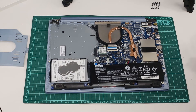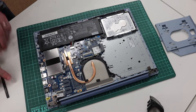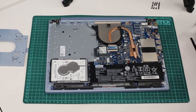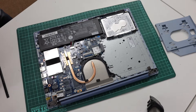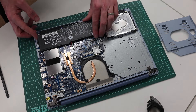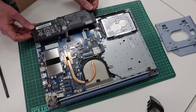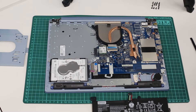The next thing we want to do is deal with the battery connector. The easiest approach is to remove the battery entirely. There are three screws holding the battery in place. We can then lift the battery up and gently pull it to release the connector. If you're having to use too much pressure, be careful — you don't want to damage the battery wires. It came out nicely and easily here.